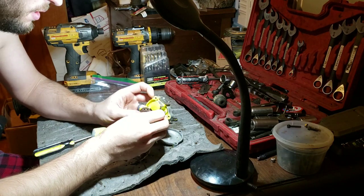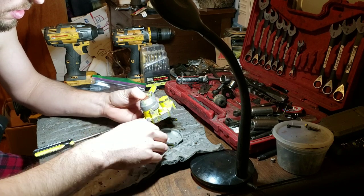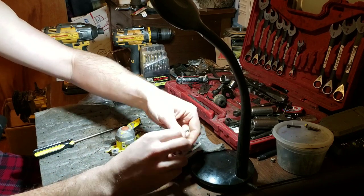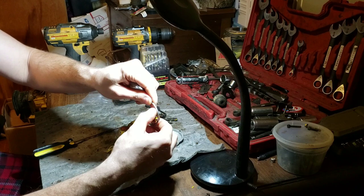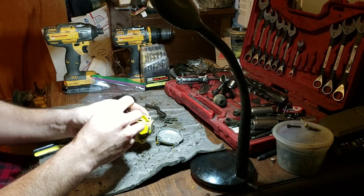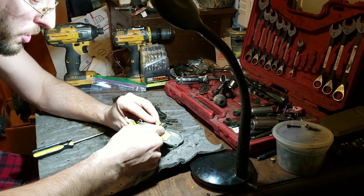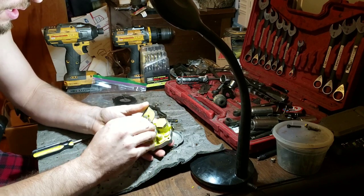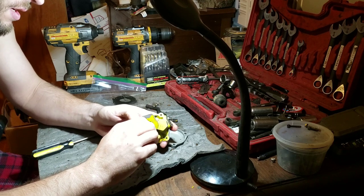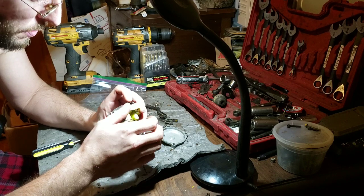All right, let's get this back onto here like so. Our bail clamp — get that cleaned out, put that over here. Bail wire clamp, whatever they call it. I made sure all the ports were clear and everything blew through clearly. Can't remember if I actually had to take this all the way off to get it on and off the saw. But anyways, jet's clear — we're gonna leave this on, this gasket looks pretty good.